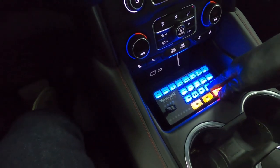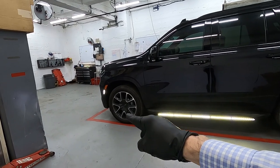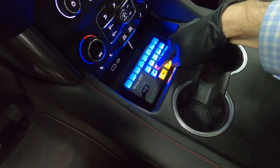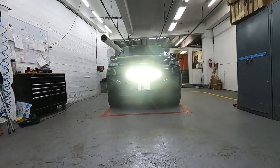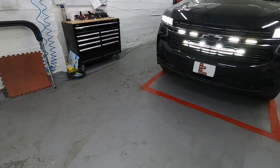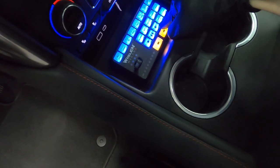Let's turn the lights off and start with take down left. Take down left turns on the front white N-Powers, the tracers in all white, and the third side windows in white. Now let's do front take down in low mode — that turns on only the floodlight. Pressing the front take down again for full take down turns on the floodlight, the four Ions in the grill, the high beams, and the Inner Edge in all white. Right take down is the same thing as left take down.